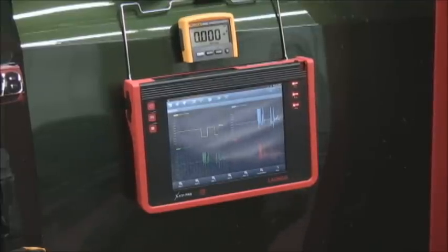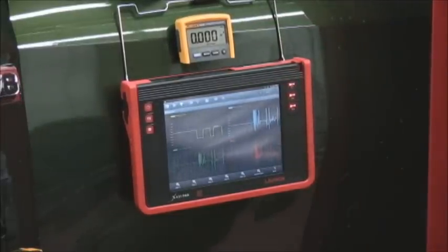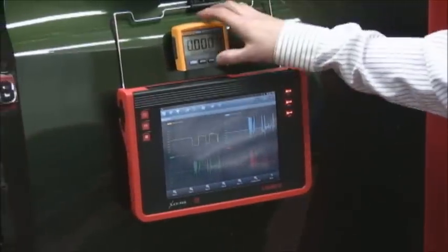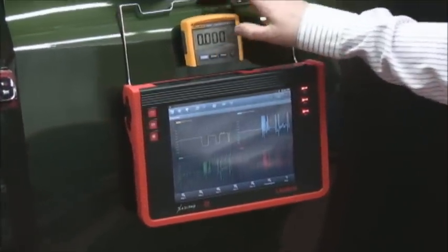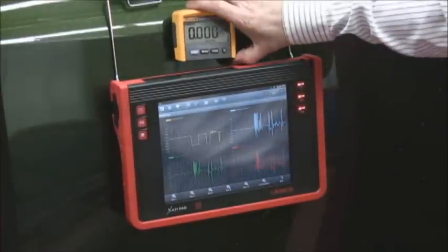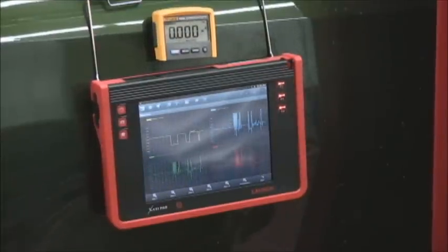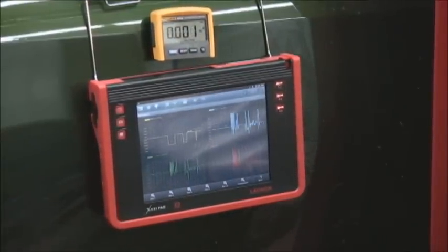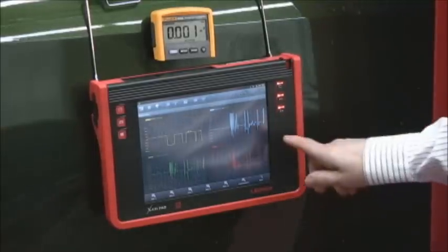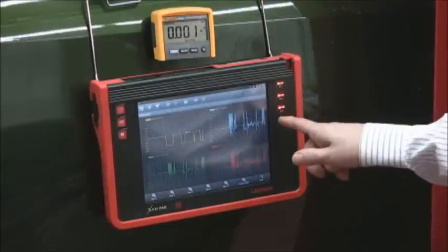Watch whenever it gives it a big blip — it's really quicker than your eye can see. We're going to go in there just a little deeper. Hit min-max. So now we're doing a min-max — we'll see what the real range is. Smack it up a little bit. There's a little delay, but then it basically ports that data out to the scan tool.